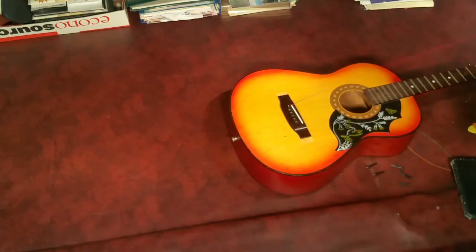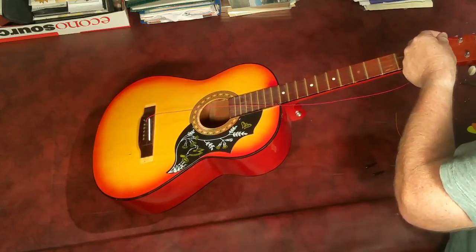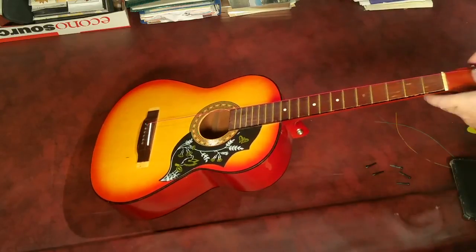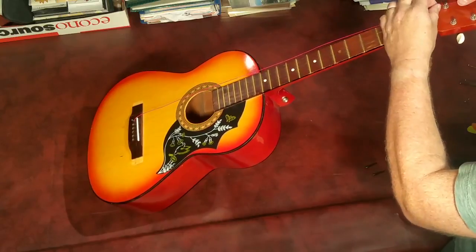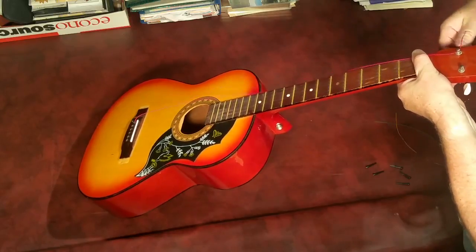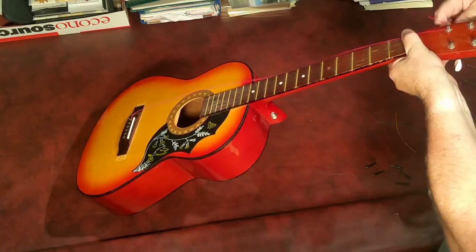It's not pulling the pin up anymore. And then, through the hole, into the slot in the nut, and typically, you don't want it right tight there. You want a couple of wraps around it, so I'll spin that backwards. I'll just spin this guy up. Give that a little bit of a kink so that it holds.